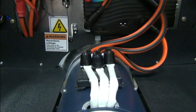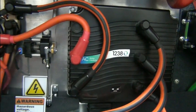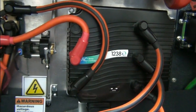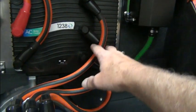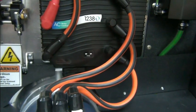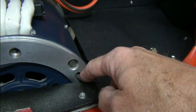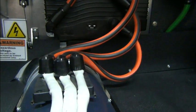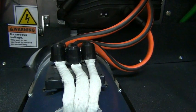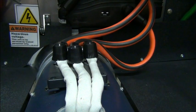In the rear of the vehicle, we've got the motor. This is a three phase AC induction motor, and we've got the AC inverter or motor controller. You can see that they're wired together with three cables — those are the three phases U, V, and W. There's also some wires right here that go to the controller, which come from the encoder and tell the controller what the position of the armature is as well as RPMs and motor temperature.